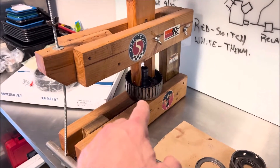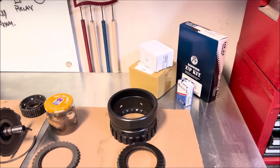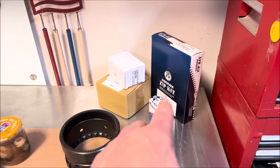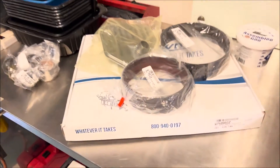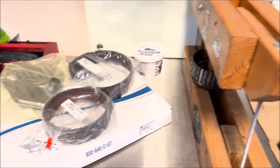I'm going to go ahead and buy a new direct drum — I actually think it's already shown up. I got it from a company called Transmission Bench. The guy helping me there, Jimmy, has made a lot of videos on 4R70W rebuilds and has been very helpful. I've got the Sonnax SureCure Kit, which is supposed to take care of a lot of the problems these 4R70Ws have. I've got the reverse band, the overdrive band — this is the total rebuild kit, plus shift accumulators, other parts, and bearings. It's all going on the new transmission.